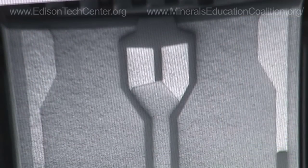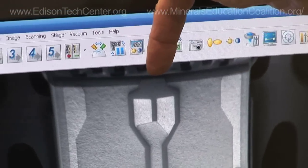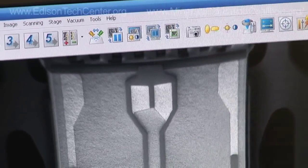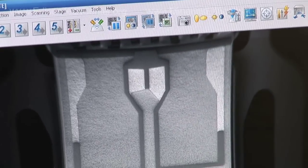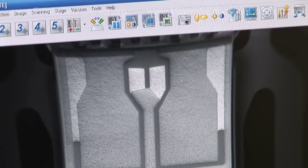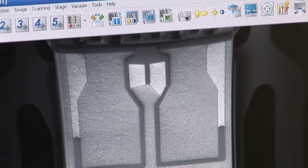Everything that we can see in this view is only to support what we call the transducer out at what is the trailing edge of the head, and it's where the magnetic flux is read and written, or where we control the flux back and forth between the head and the disc.